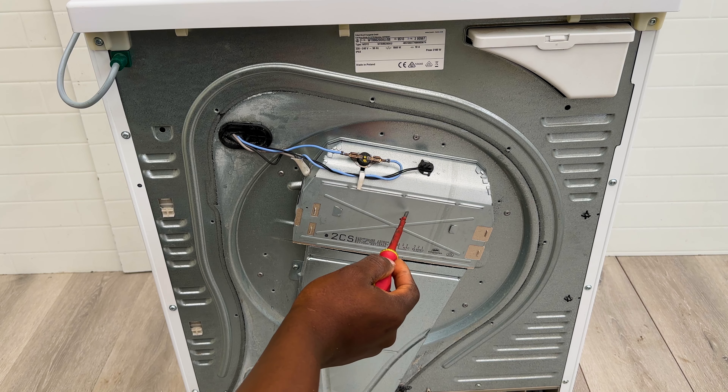You're going to need to go onto eBay. Take note of your model number and punch it in along with the word 'thermostat'. For mine I typed in 'Bosch dryer thermostat WTB86200AU' and it will show you all the different thermostats suitable for your model. Just make sure you match it up to your model — they usually cost about $59 to $60, and with postage it's about $70 or so. Once you've replaced that it should start working.